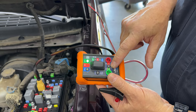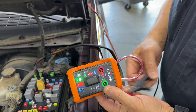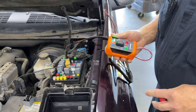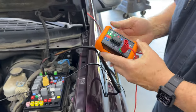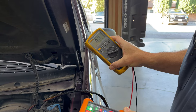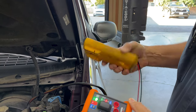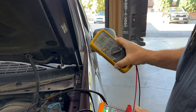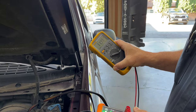So what I wanted to do is kind of check my power there. We're going to go here to terminal 85 — I've got a meter. Go ahead and go to crank. So we're getting 10 volts there. And then on this side — crank — okay, roll off the crank.